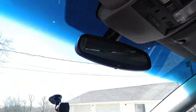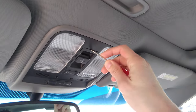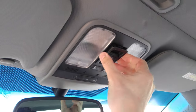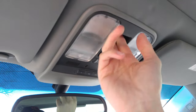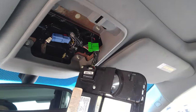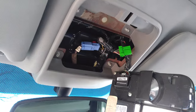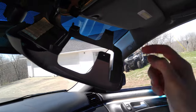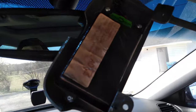So we're going to take it apart. I'm not going to buy a new one because I don't use it anyway. The sunroof switch pops out — and that was connected, I had already disconnected it. Reach your fingers up in here and give it a little tug. This is going to be a 10 millimeter on either side — actually I lied, they're 8 millimeters and there's four of them. I didn't see these two up here. Anyway, this drops down.